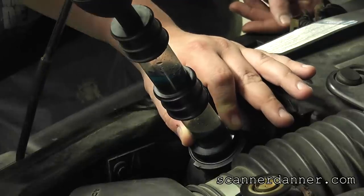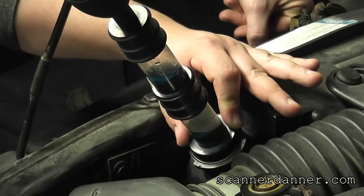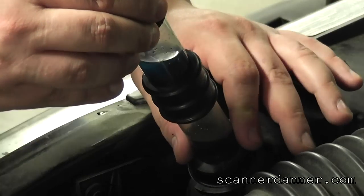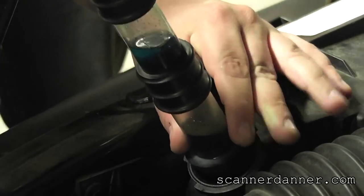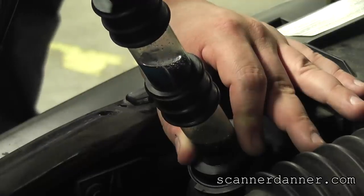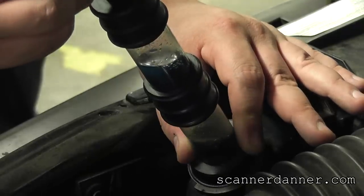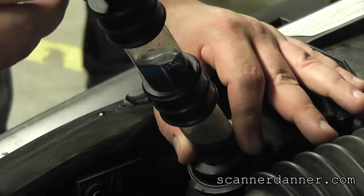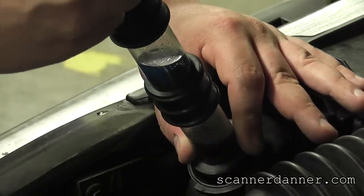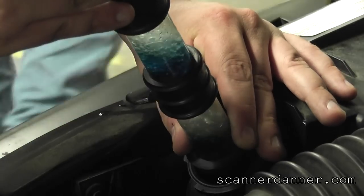How quickly is this supposed to turn yellow? It should only take a few seconds - that should already be yellow, in my opinion. I might try it with it running, but we've got to be careful. Keep doing it, because we'll have the best concentration in there. This is what I experienced last time I used this tool - I didn't get a reading off of it, but that was only because I was reading maybe eight or nine hydrocarbons on the five-gas. This one is clearly bad. I tried over the fuel filler neck and couldn't get it to change color.